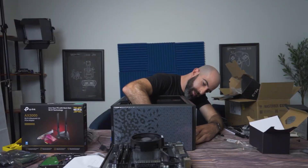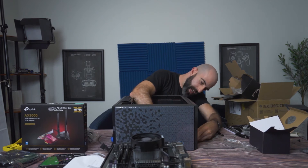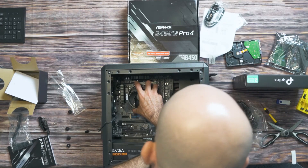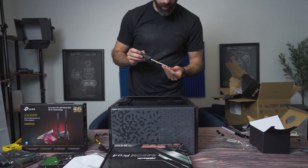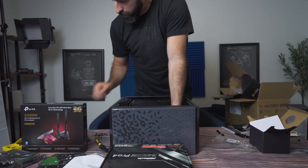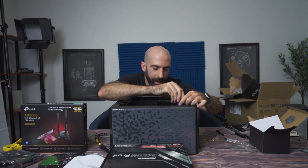There are four corners, so you'll need to push it quite a few times because every time you push a corner, another one pops out. Then slide the motherboard in and line up all your IO ports. Take your screws and install them where you put your risers. Since we were dumb and screwed the motherboard down on top of the plug, we had to unscrew it. As my dad used to always say, you're not building a computer unless you have to do something twice.